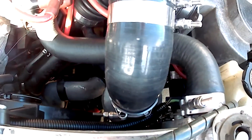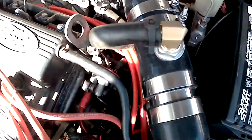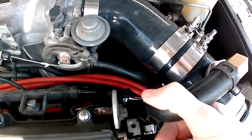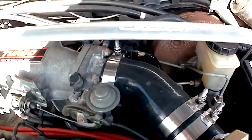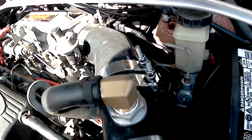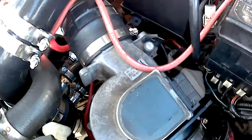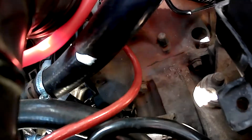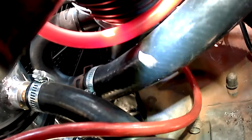I had to make this upper part here to go from the top of the intercooler to the throttle body. This large hose on top goes to the idle air control valve — older Mazda engines use this. Directly below that is where the blow-off valve is mounted. I was able to reuse the Mazda GTX intake and the GTX mass airflow sensor, which is a bigger diameter than the Escort's, but thankfully the wiring is plug-and-play. Here you can see the coolant lines better and again there is the blow-off valve piping.